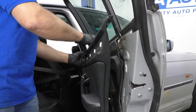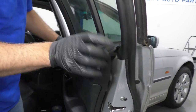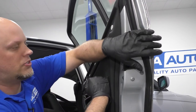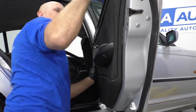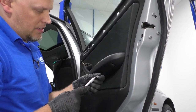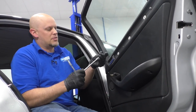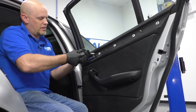Make sure your wire is through here, and if any of these clips have popped out you're going to want to take them out of the door panel. Take the lock rod and slide that in position. Line everything up, and once everything's lined up just give it a push. I'm going to take the screws with a T20 socket, extension, and ratchet, getting all screws started first before tightening them down. This last one is the long one — it goes right here. Once all of those are started, go back and snug them all up.